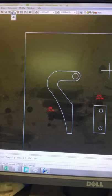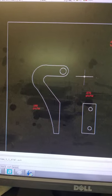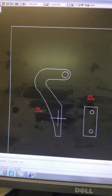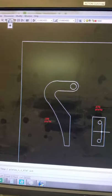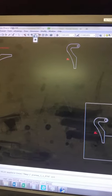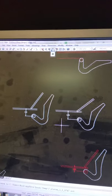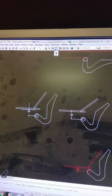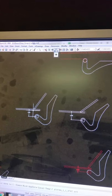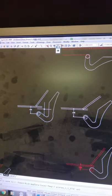Hinges. Door hinges are, in my opinion, one of the trickiest things to get working on these cars. That's the two pieces, upper and lower, of a door hinge. You've got a J-hook or J-shaped plate, and a little rectangular plate that bolts to the plate on the door. There's one of those upper and lower on the door hinges. I wanted to show you the difference between these on screen. If you get this pivot point on the hinge out as close as you can to the outer skin of the door opening or the bodywork of the car, you can see that it will open a pretty reasonable way before the door skin starts to hit against the bodywork. That's pretty disastrous when you've just put many thousands of dollars into a paint job.